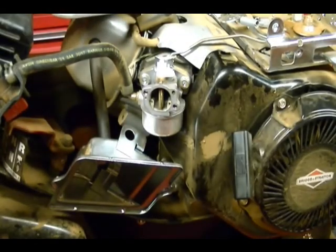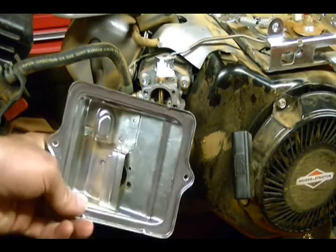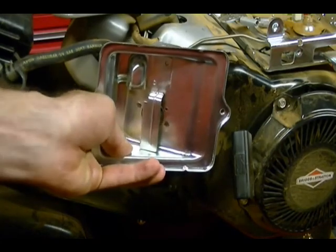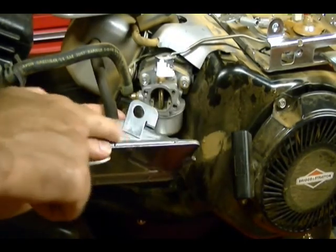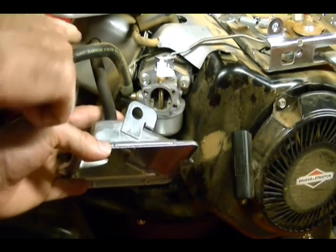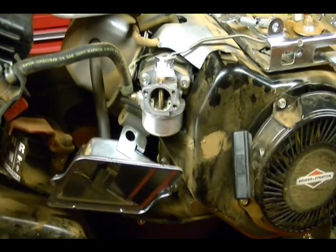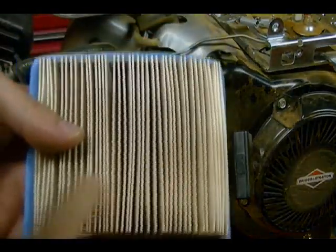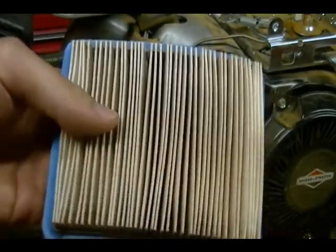What I'm going to do to correct this problem is check all of my parts, make sure everything is in good working order, fits together correctly, and is tightened down correctly. Check this hose that runs between the air filter housing and the valve cover — check it for cracks and make sure it's attached correctly. Also check your air filter element, the paper element for any tears, and the body of the air filter for any damage.